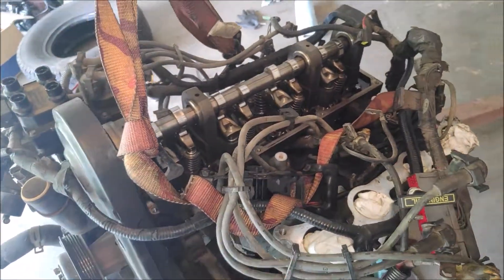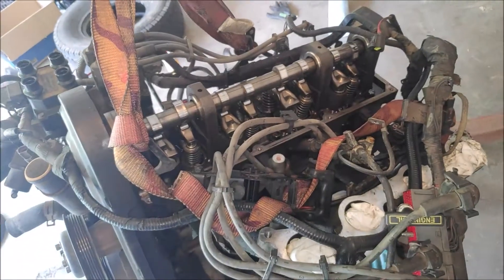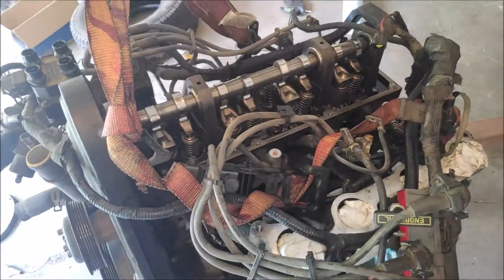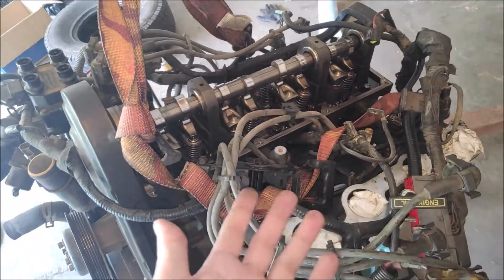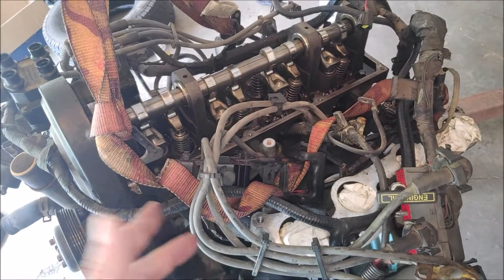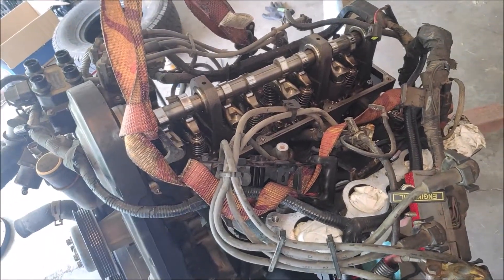You also need to change the fuel injectors. The 2.5 liter runs smaller 14 pound injectors compared to the 2.3 liter which runs 15 pound injectors. The reason is that the 2.5 liter runs a higher fuel pressure of roughly 65 psi, so 14 pound injectors at 65 psi probably flow around 17–18 pounds of fuel. The injector swap is simple — they plug right into the harness on both the 2.5 and 2.3 as they use the same style fuel injectors.